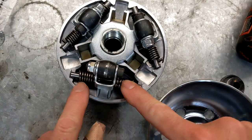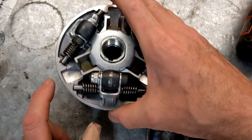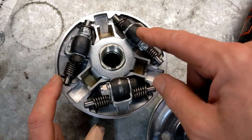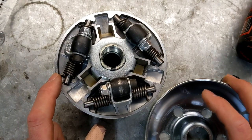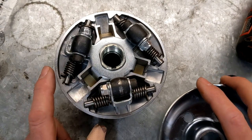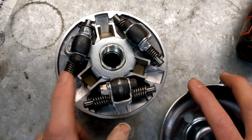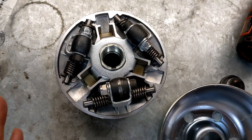You can get these springs separately, and if you need something even stiffer, in the case of OMB, they say this thing is rated for 8,500 RPM. I don't actually intend to run this motor that fast. I'm thinking I'll probably limit it around 6,500 RPM just to be on the safe side, see if I can get it to last a little bit longer. But I think this is going to fix my problem with the belt coming off. I did also buy a Comet branded belt just in case I damaged the belt that came with my clone.